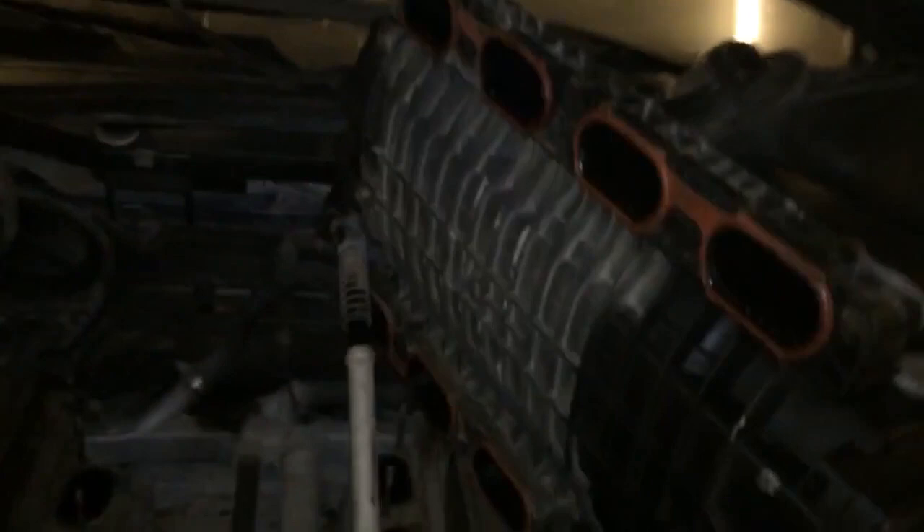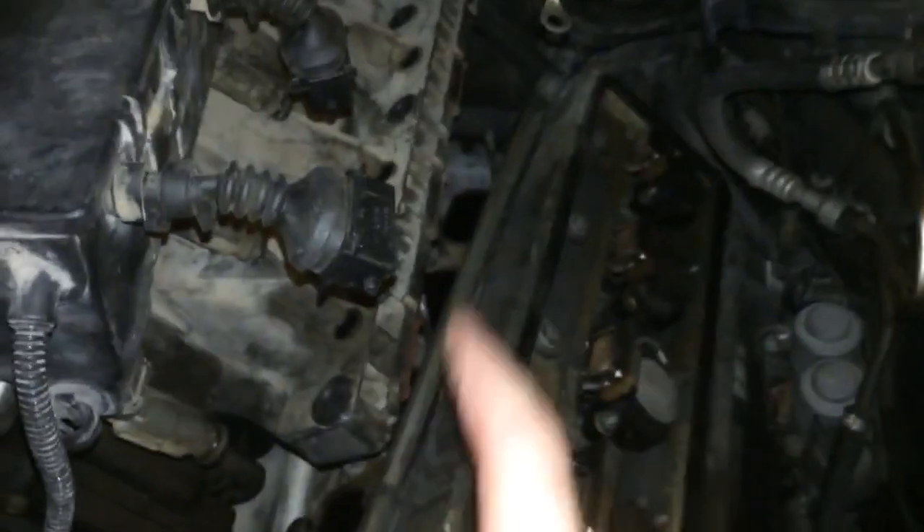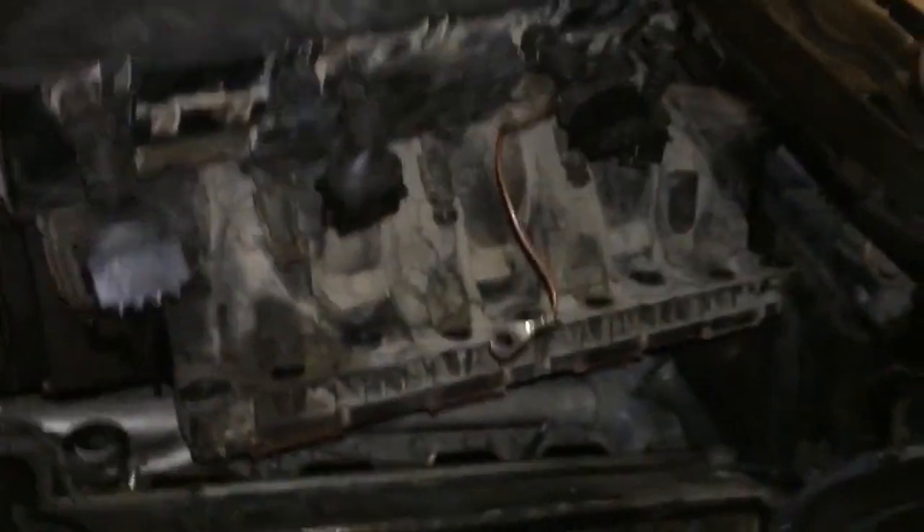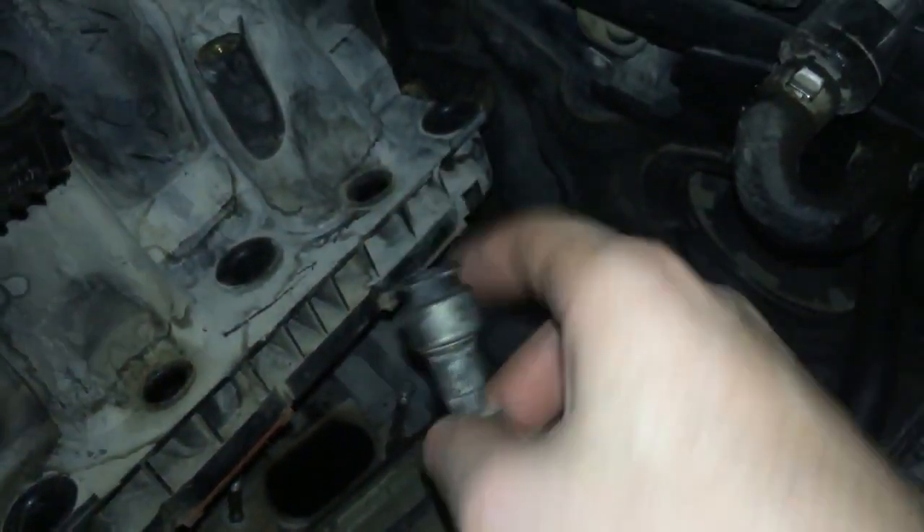So we have been removing this stuff. You have the intake manifold which is normally like that, with this being on top. So you have to remove the ignition coils — one, two, three, four. You have to remove this ground cable. You have to do the same on the other side. This is the fuel line, here are the injectors. To remove the fuel line, you have to disconnect this piece here, which is connecting to this.